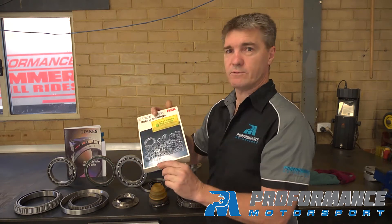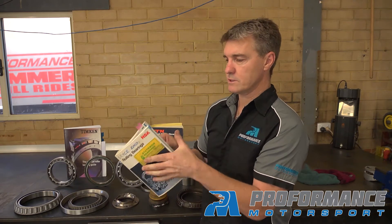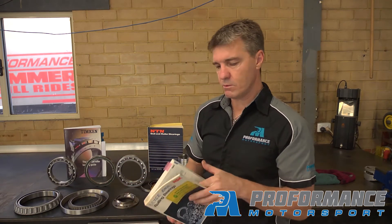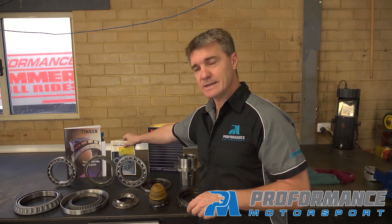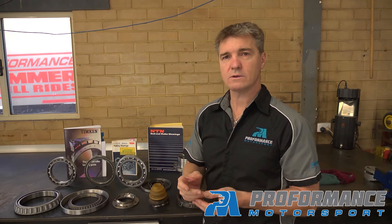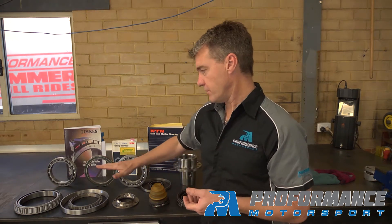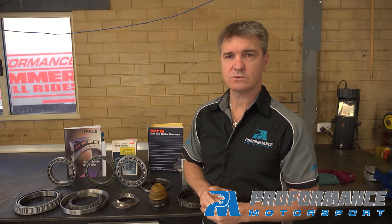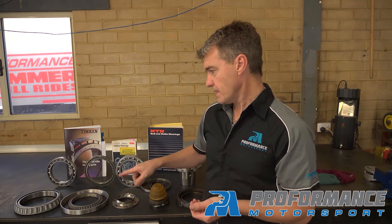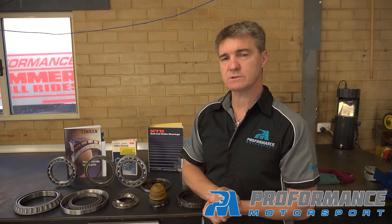We tried different oils, different viscosities, different oil levels. We had all the advice from the bearing companies, and let me tell you, these books are full of a lot of information. Typically we would bypass probably the first 100 pages and go straight to bearing selections and maximum rotating speeds. After talking to a lubrication organisation and a bearing company — and you can't talk to one without talking to the other — we found a combination of issues: running a small diameter ball or pin at high RPM is not ideal, running a thick oil makes it even worse, and oil depth is another factor that causes heat. So we went through about two or three years of testing with different oil levels, viscosities, and different-height bearings to figure out at what point the bearing can handle the high rotational speeds of transfer cases.